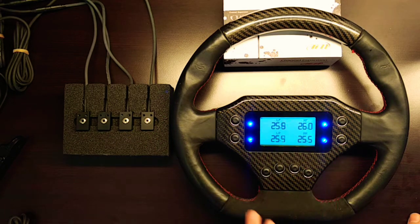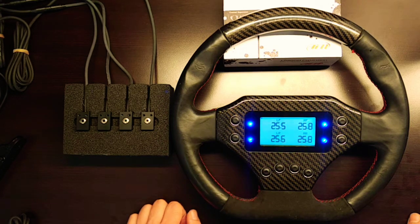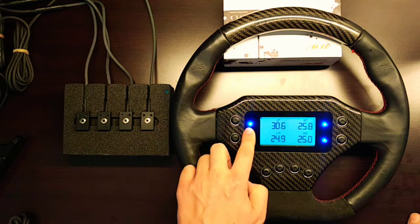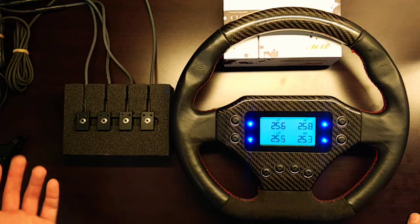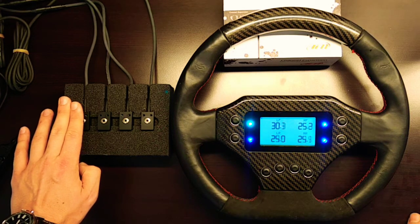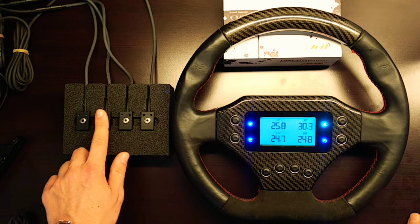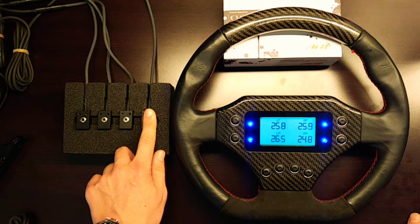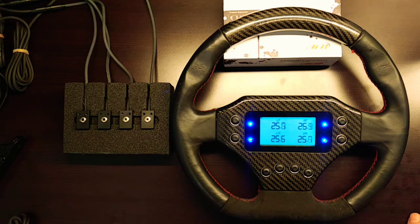The alarms are configured so that underneath 30 degrees Celsius the tire is considered cold. Placing a hand in front of a sensor turns the indicator light from blue to cyan, meaning the tire is now cool — not cold, but cool. Demonstrating with sensors one, two, three, and four in sequence, you can see how each responds to body temperature quite quickly.